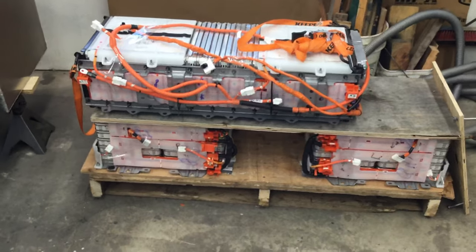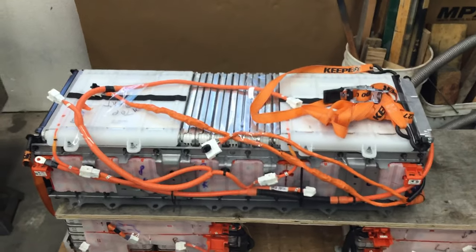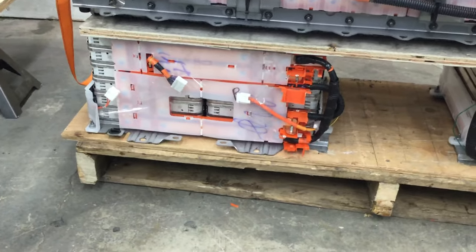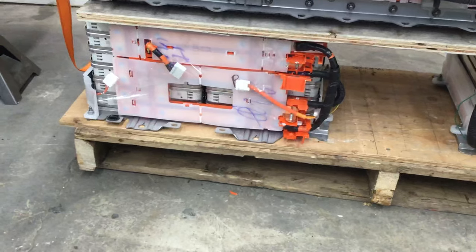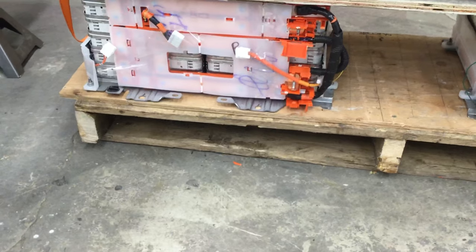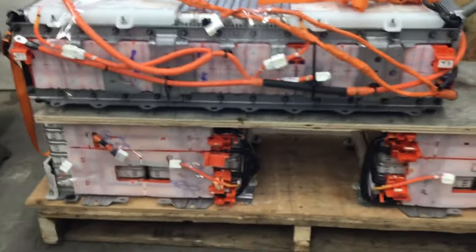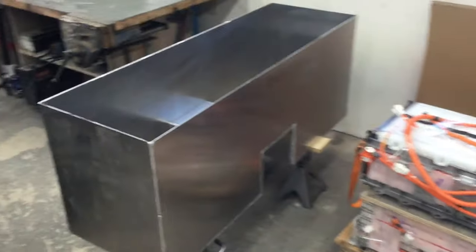On the battery reconfiguration: the original battery had a large stack in the back with vertical cells, and on each side was a stack of cells — four or six per side. I flipped four cells over on top of the eight cells, fastened them together, and hooked up the wires to make one unit. Then there's another unit, and on top of that will be the large battery pack. This view shows how it will sit in the aluminum box.